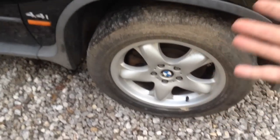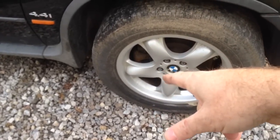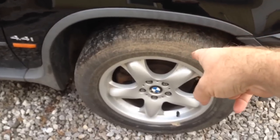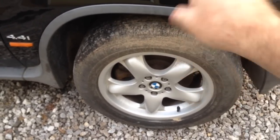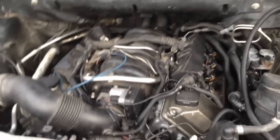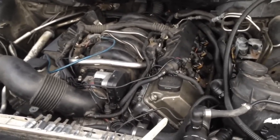When we got this thing, the tires were already dry rotted and obviously they didn't get any better. The CV boot on this side — the outer — was ripped up. They have some pretty good options now for replacing CV boots: the ones you glue together, or you can buy an OEM one if you want to take the shaft apart. I'll weigh the options and we'll do a video on that.